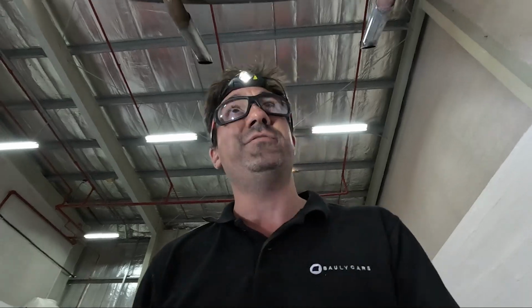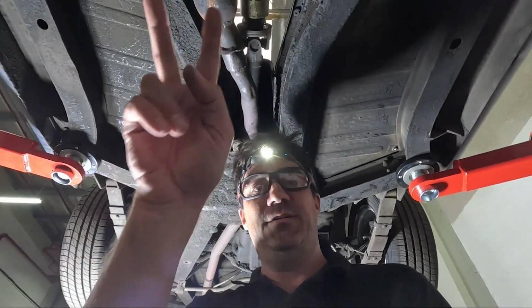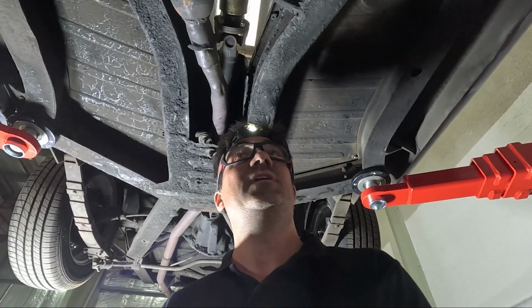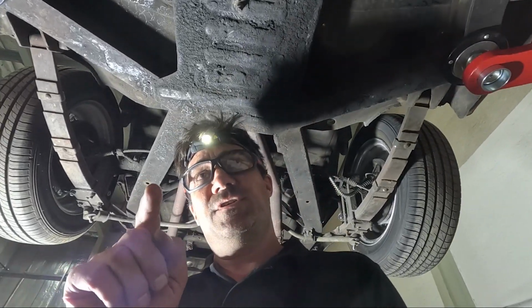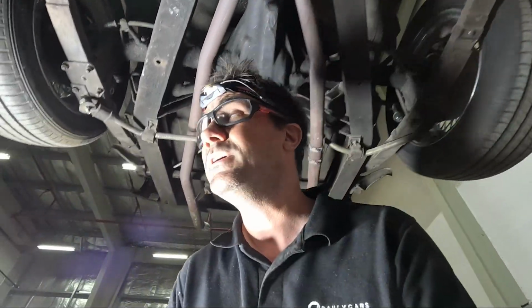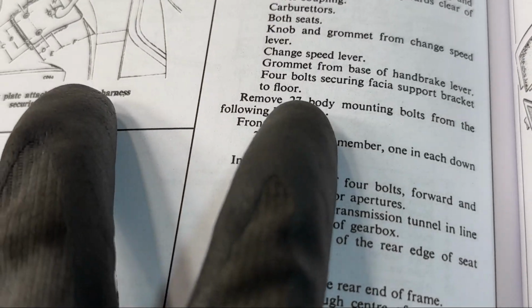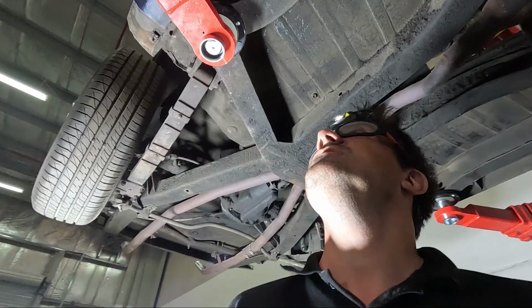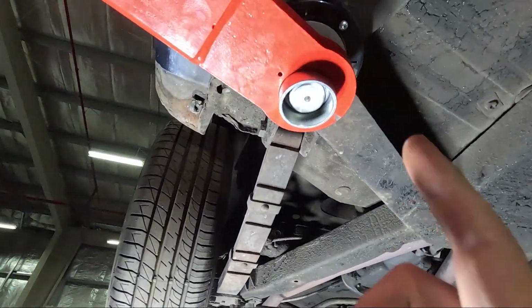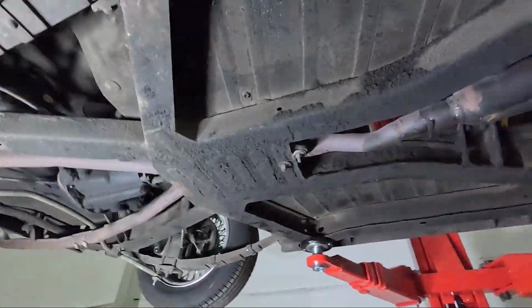All right, so all the bolts holding the body to the chassis are now out, apart from the very front two, which I shall do as the very last two that come out before I try to lift the body off. The handbook says, well, it's a TR4A handbook, it says 27 bolts. I count 25, and I think it's by virtue of the fact that this TR4A, maybe it's the US version, has a group of 3 bolts, not 4. So we're 2 down from the book.